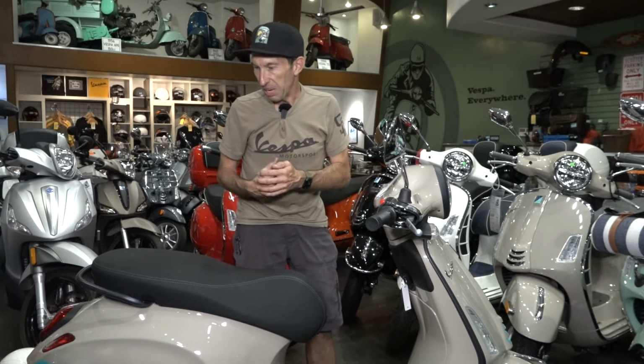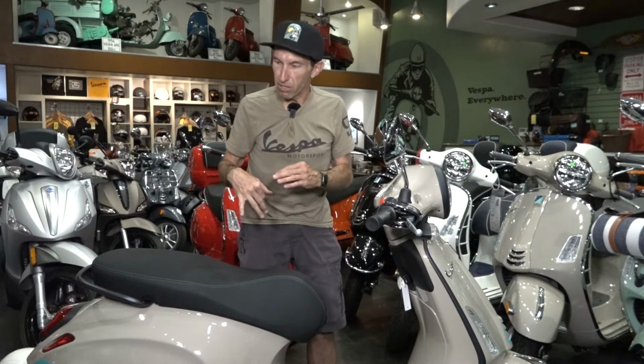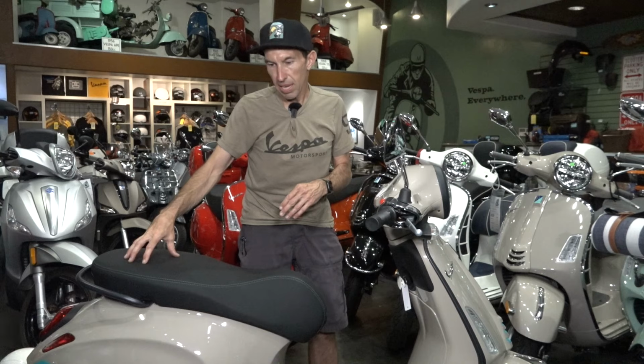Another noise that sometimes people complain about is the clicking from a hot exhaust, and also what sounds like flatulence. Once you park the scooter after a hot day, it sometimes will sound like a little belch or a fart somewhere inside the tank. There are valves that relieve pressure from the fuel tank into the evaporative emission system, and when that fuel tank pressure builds, it will make those little noises. And the clicking of the exhaust is pretty normal because the metal expands, and as it shrinks down, it makes some metallic clicking noise.